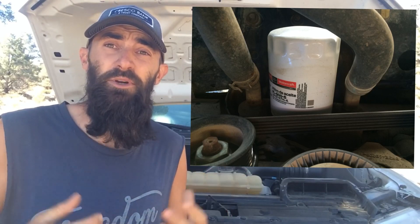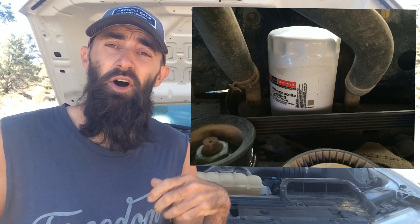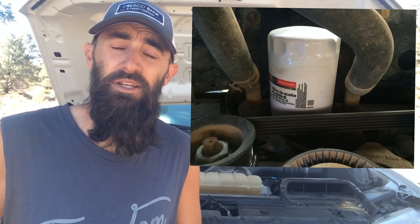When you shut your vehicle off, all that oil wants to drop back down into the sump, which means when you start it up next time there would be no oil lubricating the engine until it gets pumped back up — which is bad for your vehicle. That's why they built an anti-drain-back valve, which keeps some oil in your engine once you shut it off. If your oil filter ever goes bad, there's also a bypass built into the filter that will still allow oil through, even if it's unfiltered.